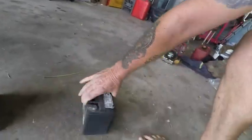So anyway, I checked it out and I thought, I better pull the battery out. Now, I bought this battery 4 years ago from Harley in Bundaberg. Was a tad over the $200 mark, so that's the original Harley battery there, and she was coming on 4 years old, and the bike did sit for quite a long period of time in that 4 years where I didn't ride it and I hardly ever put it on charge, so I sort of knew it was on the way out. But anyway, I took it down to our local mechanic and they tested it, and only 80 cranking amps out of about 300. So basically that's a dead battery, so 4 years, no worries.